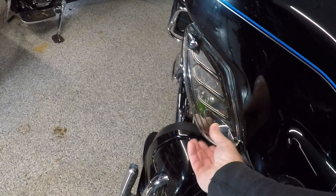So I think that pretty much covers the features. Let's go over some of the issues — the known issues with this bike that I was told of whenever I purchased it. First thing is the volume doesn't work on the stereo — it's got no audio output. If I increase the volume, nothing. It could be a bad amplifier, could be a broken wire — I'm not getting anything out of it.